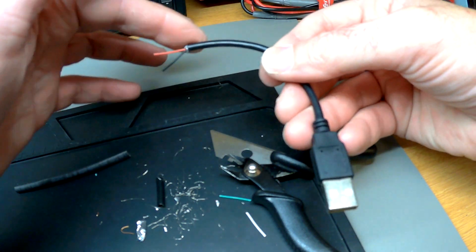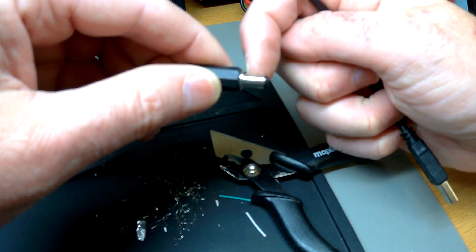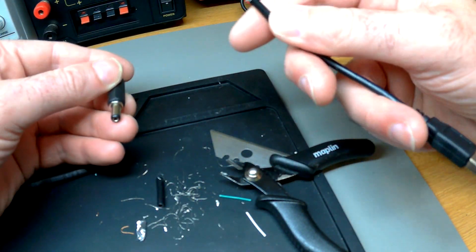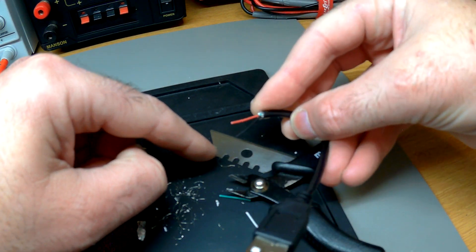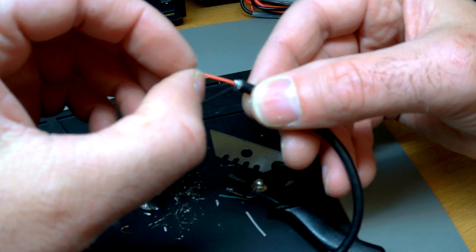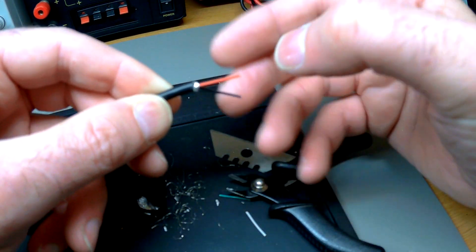Your red and your black will go into the buck converter on the outside - you've got your little tiny plug socket, which by the way Dave you want these. They call them like 12 volt plug sockets but there are different sizes, different lengths of the male. So you want one of them - a female - and then what you do is go at the back of the box: power in, then to the switch, then to the buck converter, and then this coming out will be your micro USB Samsung plug on the end. All you want to be left with is the black and the red - cut a bit off on the end, put some solder on it so it's nice and tinned. I tend to fold it back and then stick it in the buck converter and you'll get a good contact.